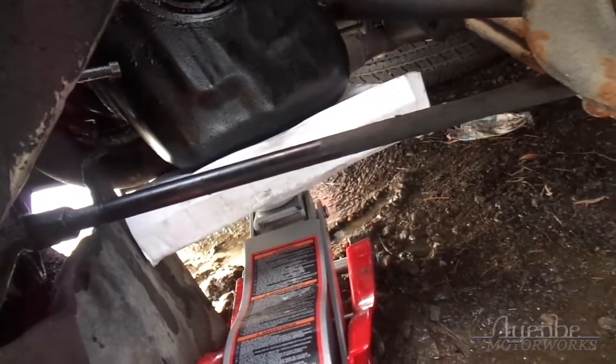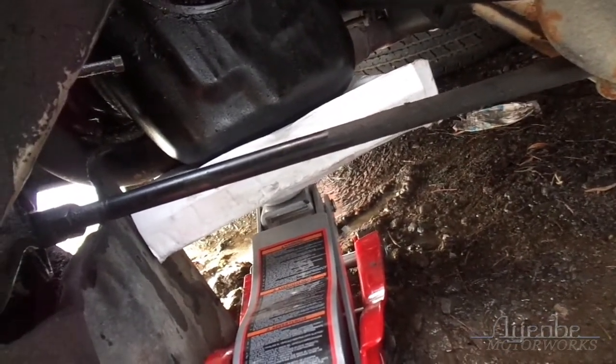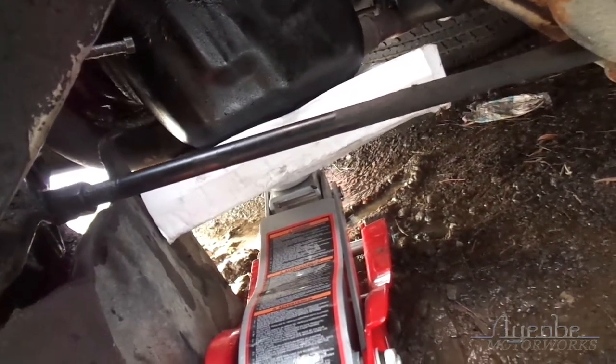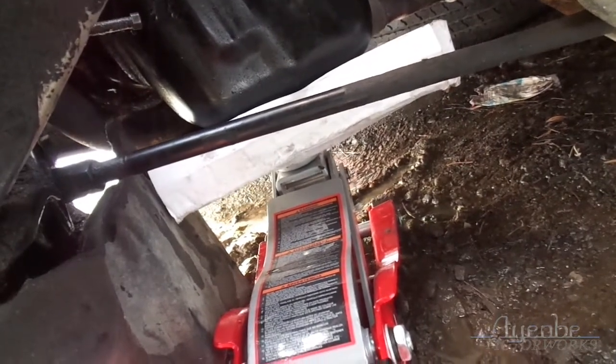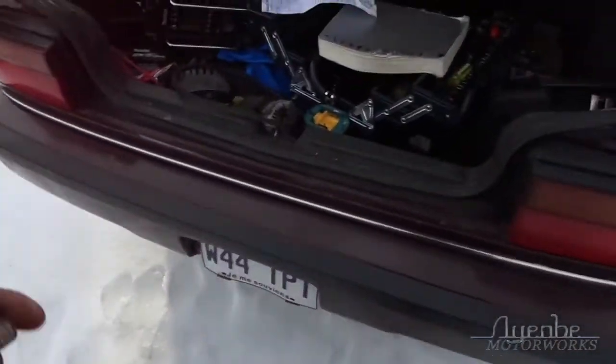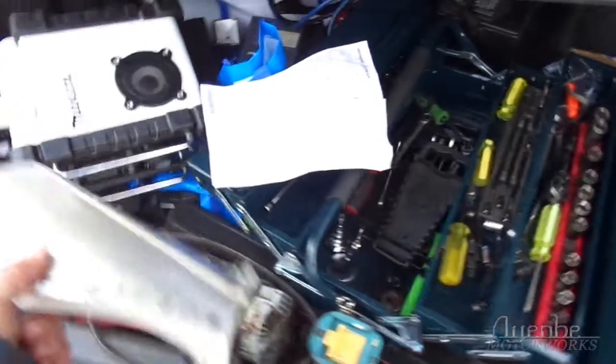So, I did exactly what the motto suggests, and instead of wood, you know, wood is cheap, I decided to lift the engine a little bit to be able to take the engine mount from the front off with the brake disc in a box. That'll keep the engine happy, and it looks super solid. So, we'll do that. I'm pretty sure the brake disc center bore is bigger than the little foot on the jack, so it'll be really safe and stable.